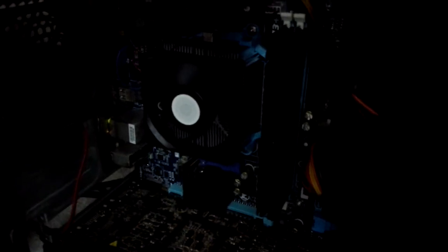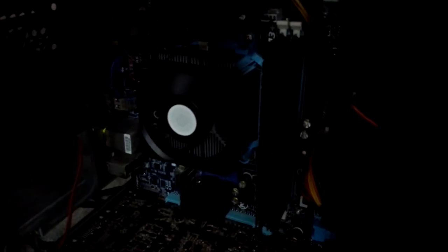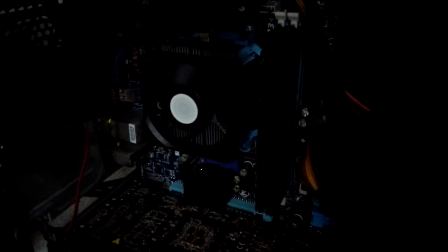Now, what's funny is that this is a very cheap, terrible motherboard, but it does support any AM3+ CPU that is 95 watts. So you can't do anything more than the FX 8320, but you can do the FX 8300, which happened to be on sale today for $115 on Tiger Direct.